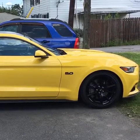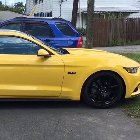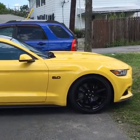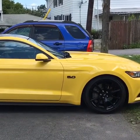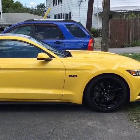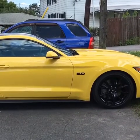I can tell you that if you did get these springs, the springs for the front are the wider spring setup, and the coil towards the top is a little closer than the coil on the bottom, so that's how they go in. I did read online that they only go onto the strut one way, and that was the only way we could really get it to go on where it looked right and didn't look all cockeyed. So the tighter coil goes towards the top. When it came to the rear springs, the only thing I found was they said that the lettering should be facing upward, so no left or right. The funny part was, there were 3 of us looking, and we could not find any lettering at all on the spring. There was a kind of mark, it looks like maybe where they hung the spring to powder coat it. So we just put both of those up.